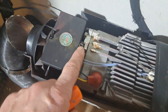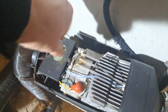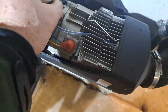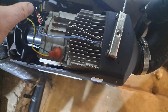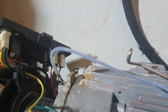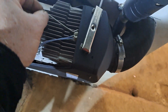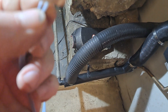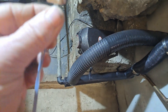We've undone the little clip and we now need - just the end of the screwdriver - you can see there's a little allen key bolt - undo that, take that out, and it should reveal the motherboard. There's a little clip there you pinch together with your thumb and forefinger and you can reveal the motherboard. It's this connector here we're after - a square connector - you get that and it comes off the motherboard. The little ceramic temperature sensor comes out and the problem with this one is one of the wires has come out the end, so that's no good.